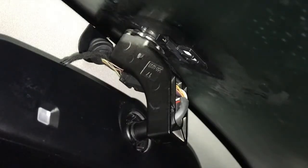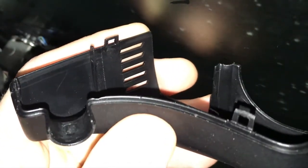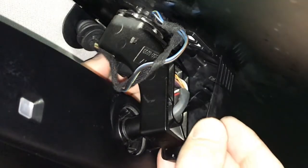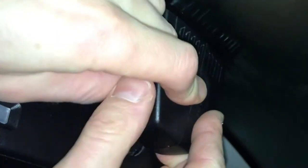The mirror goes on at 45 degrees from the angle that you want it — make sure it's on there solid, then rotate 45 degrees clockwise, and there we have it. Now we're going to reattach the mirror connection and the condensation sensor. When reattaching the housing, make sure none of the three clips are broken — if they are, you'll need to replace the housing. And there is the completed repair from the outside. Thanks for watching.